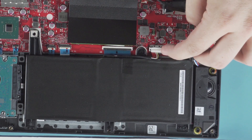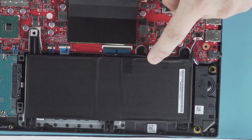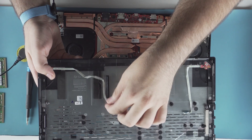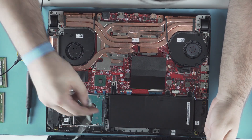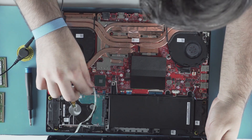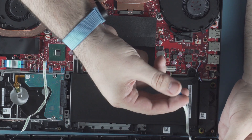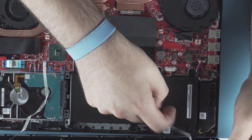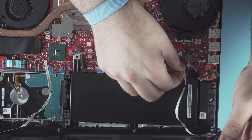We're going to go ahead and plug the battery back in. When you do plug it back in, make sure you put the metal piece back in place. When you go to put the bottom panel back on, remember it has these LED connections at the front. Make sure the connection is open — there'll be a tab. Once you get the cable in there, go ahead and press that down. The little blue pieces have a marker that lets you know they are all the way inserted, so keep that in mind and make sure it goes all the way in before you press it down.